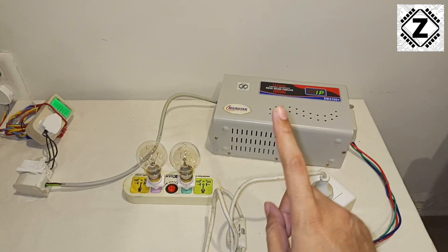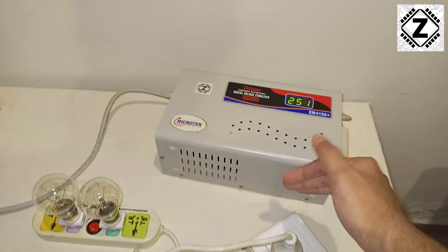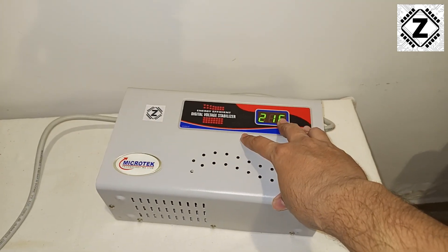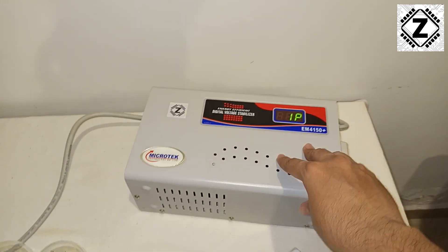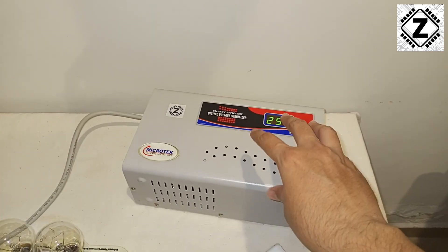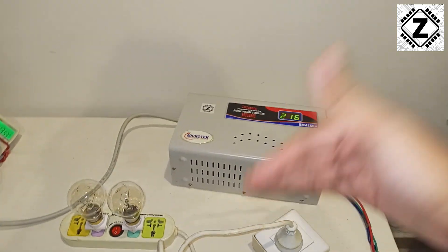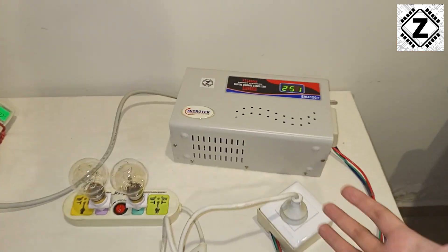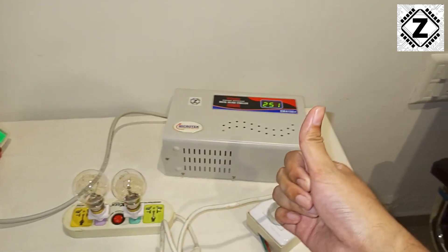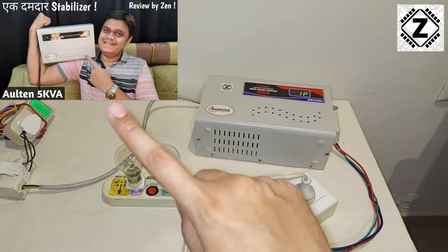There's only one recommendation I can give: the life of your home appliances — your air conditioners, TVs, computers — is much more important than minuscule savings in power. Please don't install stabilizers just for that power-saving factor. You should absolutely install them to safeguard your home appliances against voltage fluctuations, spikes, and brownouts. Longer-lasting appliances are actually more eco-friendly in the long run — dead gadgets end up in landfill and pollute the environment. So yes, I do recommend using a good stabilizer even if it might increase your electricity bill slightly. I already have a dedicated buying guide video available.